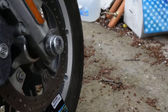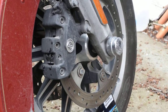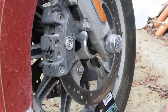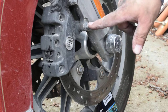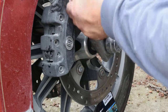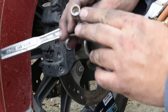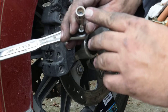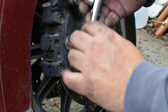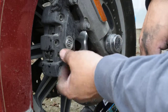You don't need very many tools at all to do this — really just three things. You're going to take these two bolts out right here to take off the caliper. The heads are not a star pattern. A 10 millimeter 12 point does good on that. And then you're going to need a 3/16 Allen wrench — that's going to release that bolt right there that holds the pads in.